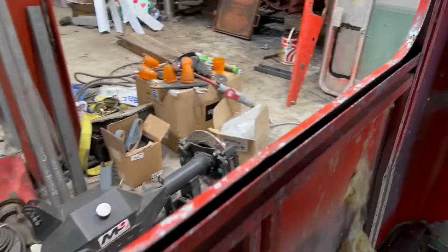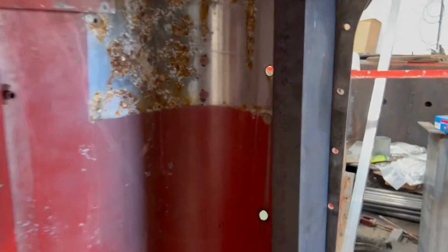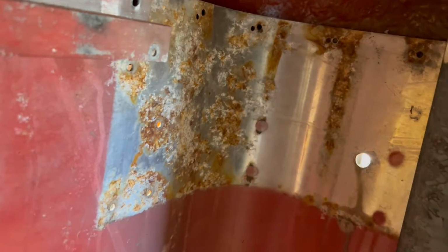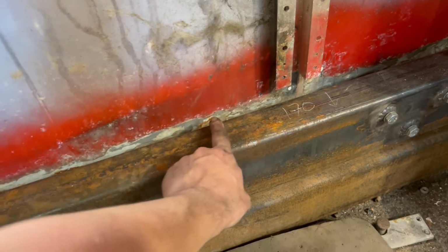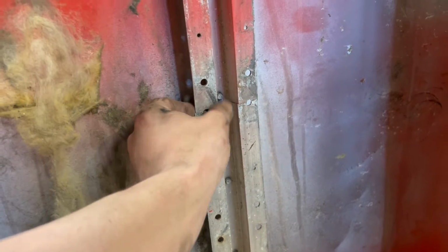The rear corner pieces clashed with the internal steelwork as well, because this is 10mm deeper than the original. The faces are the same side to side, but this is obviously deeper, so I'm going to remake them and tie them into the steelwork that supports the new sleeper opening when I cut that, because this is going to come down all the way to here, so I can have a walk-through sleeper. It'll also replace this, which is obviously buckled from when it got hit.